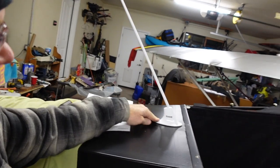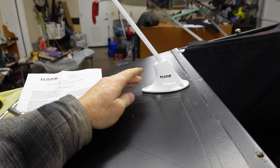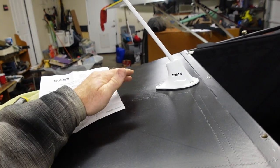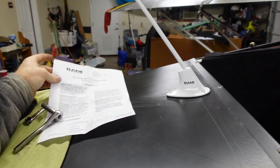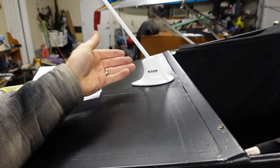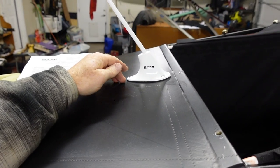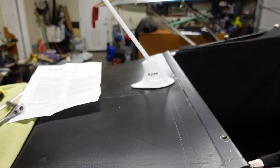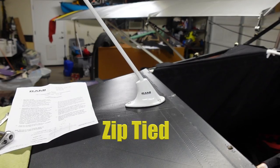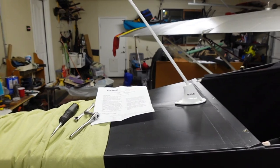I got the antenna properly mounted — it was more than just putting the screws in. A lot of people ask about the grounding plane. The plate that's welded to the frame back here is what I used as the grounding plane as per the instructions on the Rami antenna. I did put this rubber seal in, and there's a backing plate on the back side that needed to be ground down just a little bit to clear the weld on the inside. The coaxial line is run to it and zip-tied in place up out of the baggage area. It was a little more time consuming than I thought, but it didn't take very long.